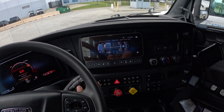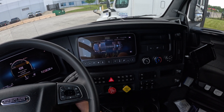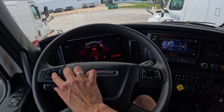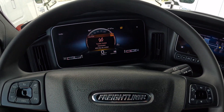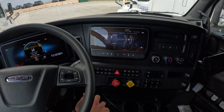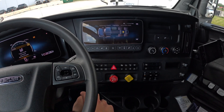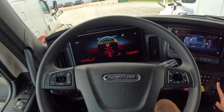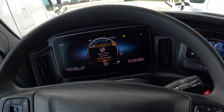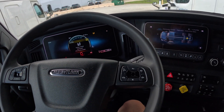The yellow light means your differential is engaged — both axles are spinning at the same time, the axles are locked up. If turning on the differential lock alone didn't help, I recommend pressing the ATC Spin button to deactivate traction control. This means the engine won't reduce power to the wheels, giving you more power and a better chance to move out. If you're on a hill, I also recommend turning off HSA — this allows you to move on a downhill or uphill where power may have been reduced.